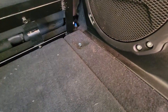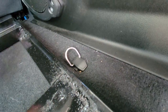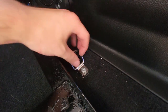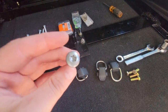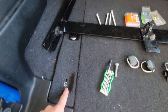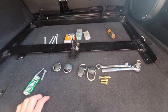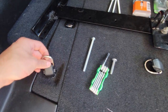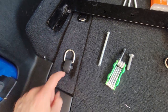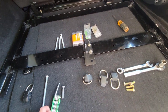All right, so once you get your frame built — you can see those three spots. They all three had these clips, and in order to get them off, all you have to do is pry that up. Get a flathead screwdriver and just pop it up right there, and that gives you access to a T40 bolt. Those are all Torx 40. I've got one right here, and I only remove the four corners because the middle ones will be fine to stay. Now we can start putting our bigger bolts in — the bolts that are going to set our seat up higher — and put these clips back down inside here. We'll put those back in place, take this cover off, and then we'll be able to start bolting the frame into the Jeep.